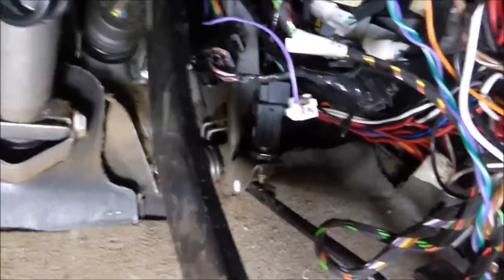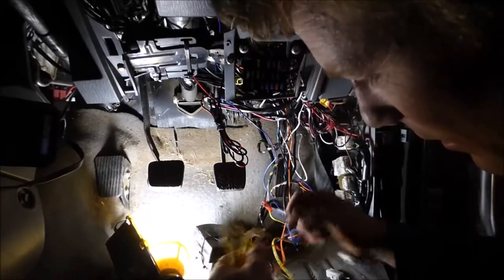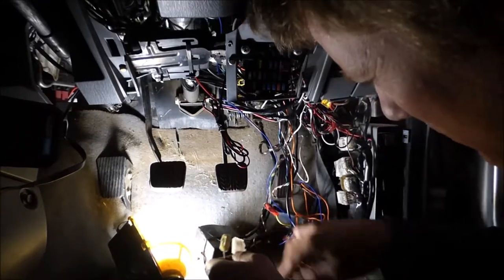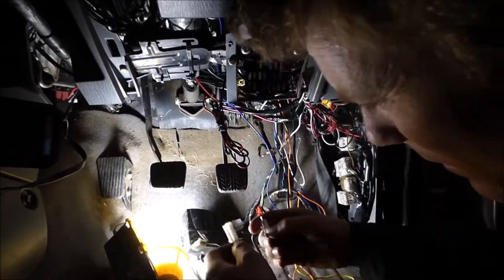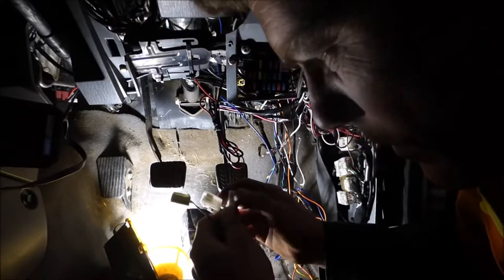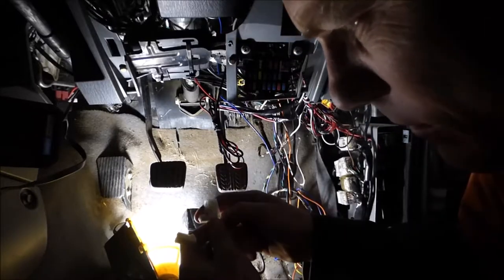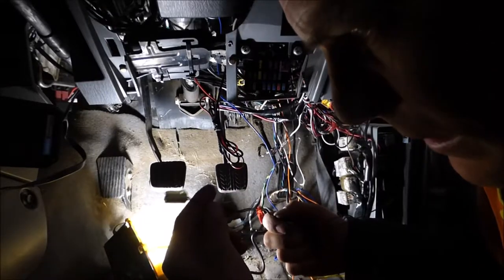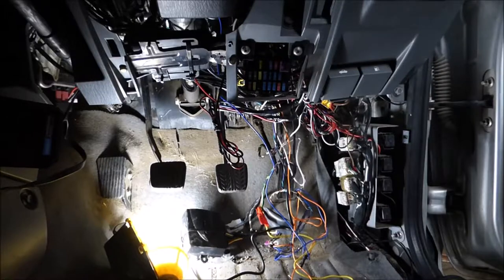And your orange wire — we'll have a bit of a look down here. It's a bit messy, which is why I haven't packed up the wiring yet. Yellow — I've left it, it just doesn't get used. These are just examples of the wires. So with that big wire — these are the wires. That's your brake, that will be your clutch wire plug, your brake plug, and this is your throttle plug, which has to be completely unplugged and you plug into the purple. So that's the only one there.